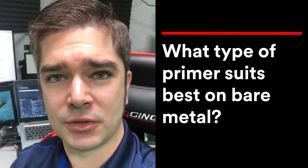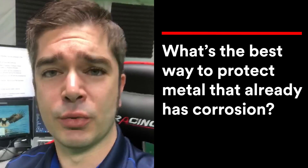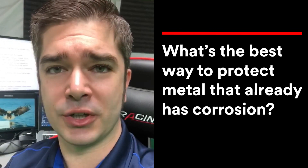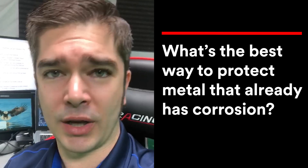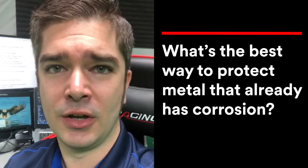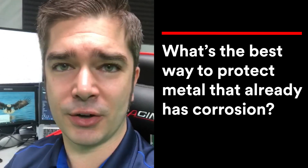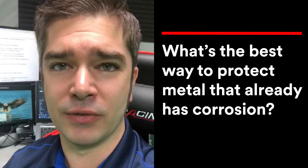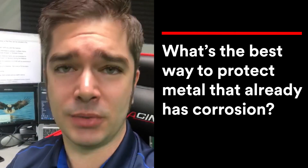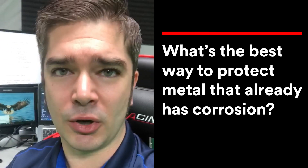There's really no magic bullet for corrosion other than actually replacing and removing any rust or corrosive material from the vehicle. If you find yourself with a lot of exterior rust, you're going to have to sandblast it, cut it out, grind it out, or remove it — possibly resulting in replacing the panel. Always refer to the OEM recommendation for a situation like this.